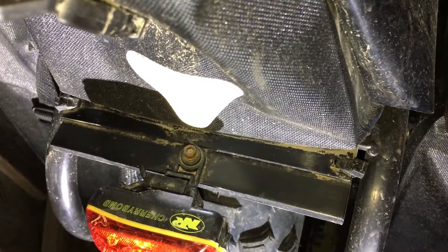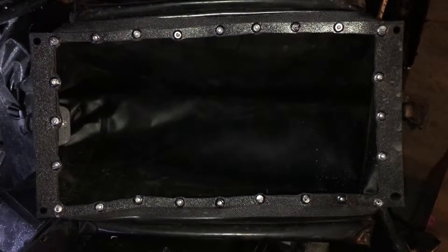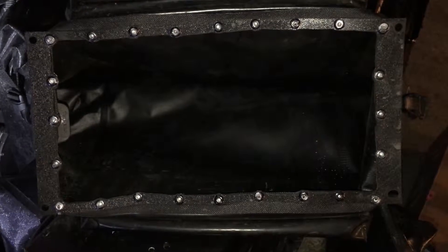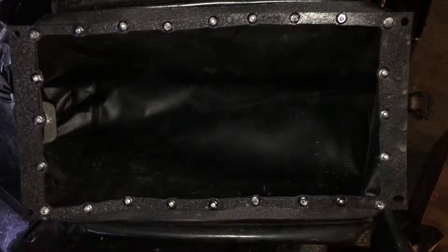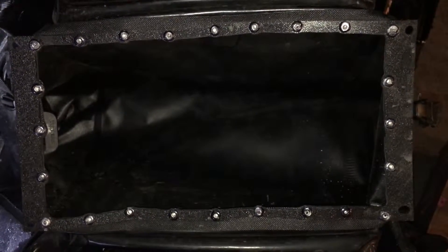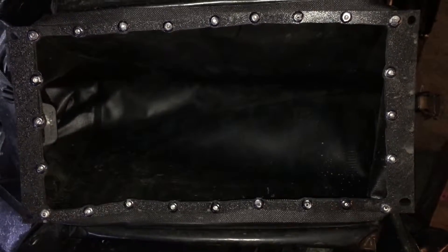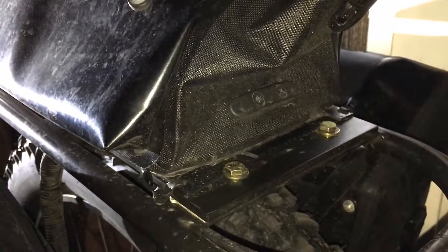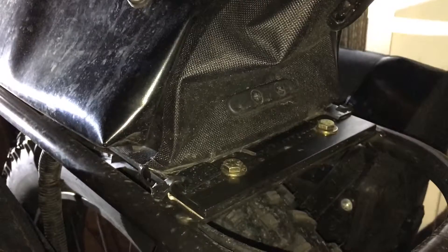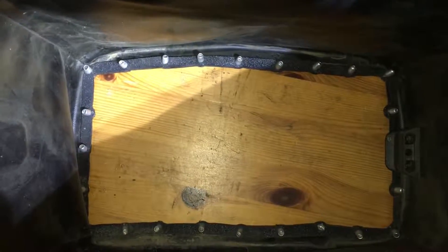I also need holes to attach my trunk bag, which has an ABS frame in the bottom. The trunk bag has a big hole cut in the bottom of it to house and hide the controller, and those four holes on the outside of the ABS rectangle are what I use to mount the trunk bag and controller housing to the heat sink. I drill holes in the heat sink and use zip ties or cable ties to attach the ABS frame — they're lightweight, economical, and they don't corrode.